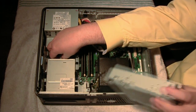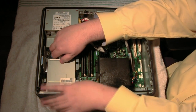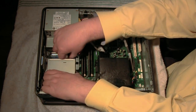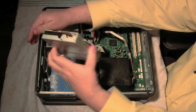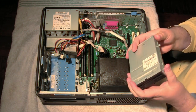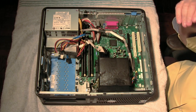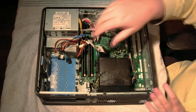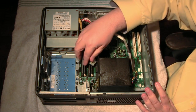The next thing I want to do is pull the wires off the back of the floppy disk. Once the wires are disconnected, lift up on that and bring it out. Now it's unusual for a computer this new to have a floppy disk, but whoever ordered this ordered it with one. I don't know if you'll ever use it. And that exposes the drive bay in this computer so I can mount my drive in here and bring the computer back to working condition.